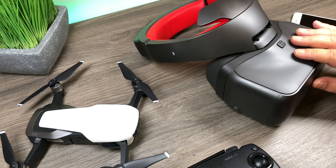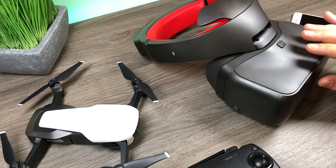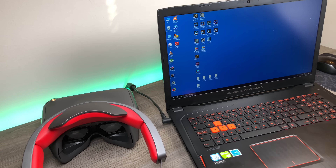All you have to do is download the DJI Assistant 2 app onto a laptop or computer. You plug in the goggles and the app will recognize them right away and prompt you to update the firmware. Make sure you have the latest version of DJI Assistant — if you don't, it won't recognize the Racing Edition goggles properly. You can download it from the DJI website; I'll include the link down in the description.